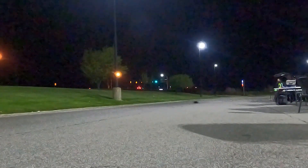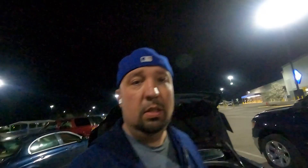Let's start with Friday night. We're out at the night spot and I've made one hit — a really soft hit, just a 2.8 at 55mph. On this second hit I've just increased the ramp and the curve a little bit on the sanwa and see what we can get going. That was quite an improvement from the first hit, so we're just going to keep working the remote a little bit and see what we can get out of it before we start messing with the ESC. Running zero degrees of cheat right now.